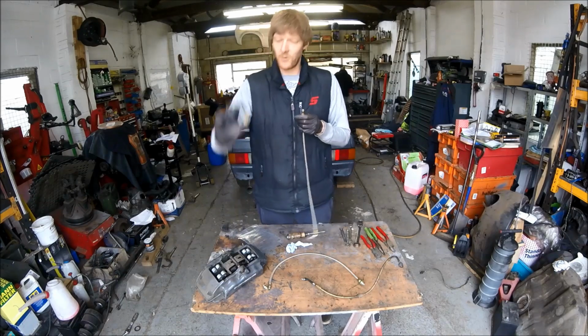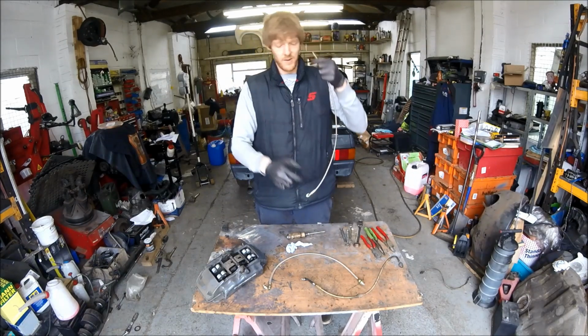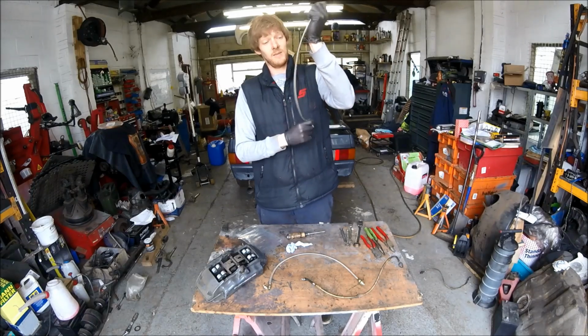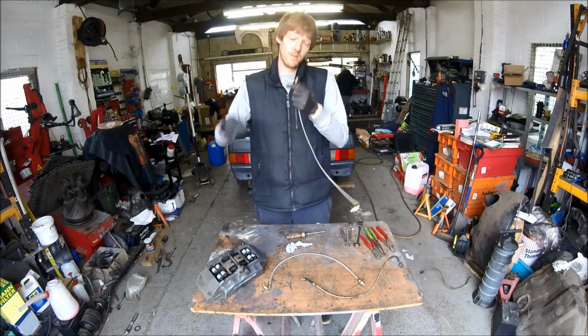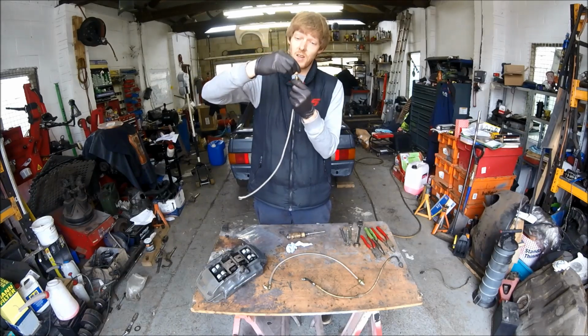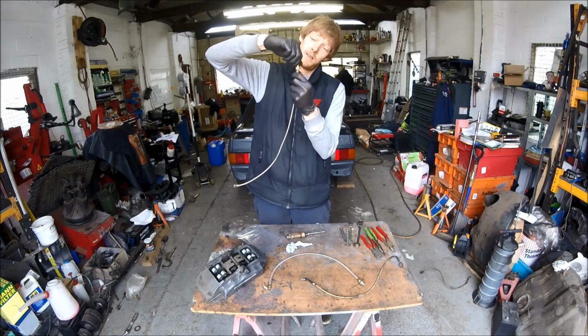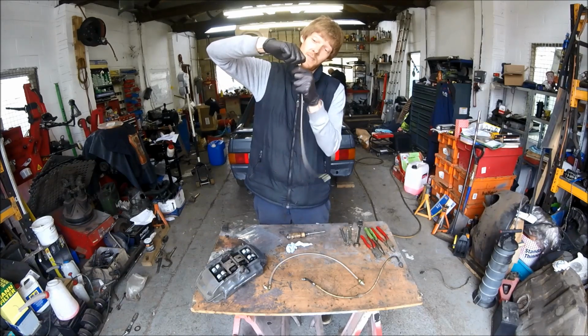And then this time we've got a bulkhead fitting, so this is the bit that will be fitted to the car. That will sit on the caliper, then that will go to the body shell. And then again, little insert, push that in and then turn the fitting rather than the pipe. Turn it, turn it, turn it, and then it will bite up.